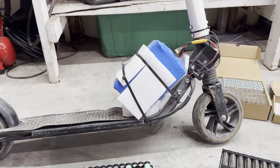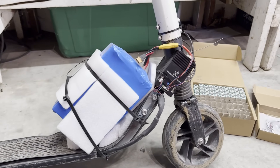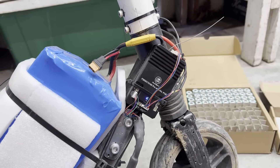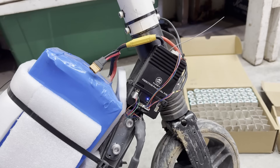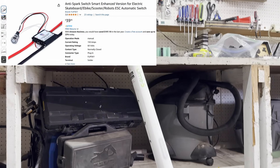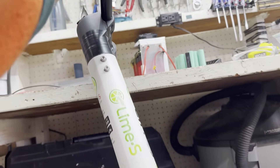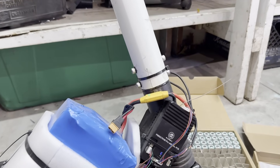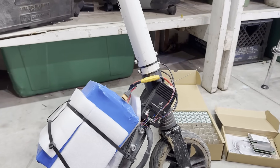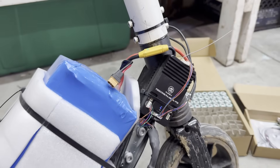There are also some other reasons I'm changing this build. First off, this battery is super janky just having it zip tied on. Second off, I really don't like this controller. This controller is a VESC controller, which means it's super programmable — it's a 75100 Pro from FlipSky — and it has some things I don't like, such as you have to buy a $40 anti-spark disconnect if you want to be able to turn the scooter off. Right now I'm just leaving it plugged in, because this anti-spark connector here fried immediately when I used it, so I have to choose between leaving it plugged in or sparking it non-stop, which will eventually ruin the connector.